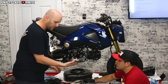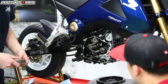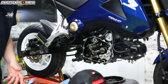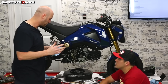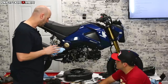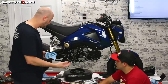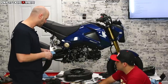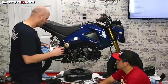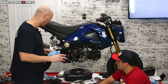This week, we're going to leave the Koso plates off, take the stock clutch and basket, and just put that back on with stock springs, then pick it up again next week. If we get everything in by next week, we'll just take it apart and flip out the basket and do it the right way. We showed you how the slipper clutch goes together — the issue was where we were tightening it, that's where we messed up.